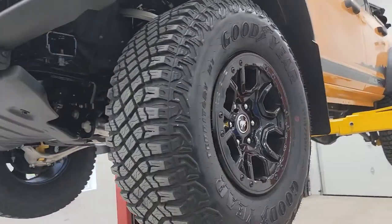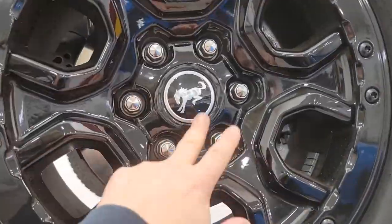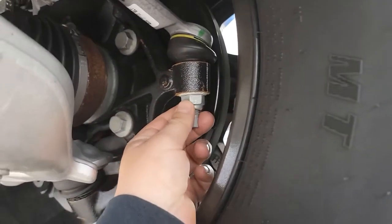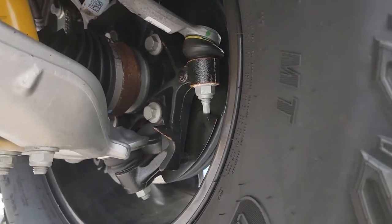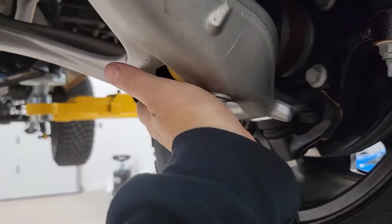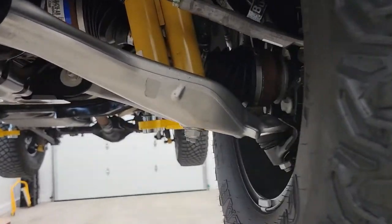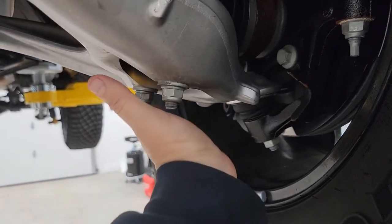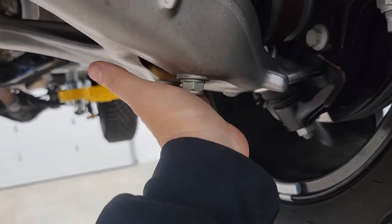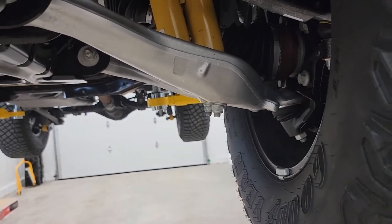The first step is we're gonna take off this wheel. We're gonna use 19 millimeters. We have a power tool and then we're gonna remove this — in this case it's a 21 millimeter. If you're jacking, you can jack under here. I'm lifting the car today because I have the ability to do that. Bronc Buster said to put a jack under these bolts and capture this area — that works well as a jacking point. That was a good tip.